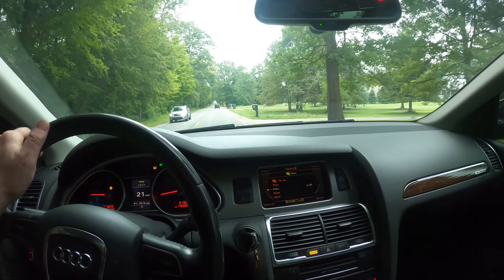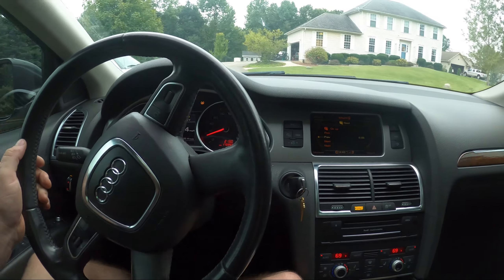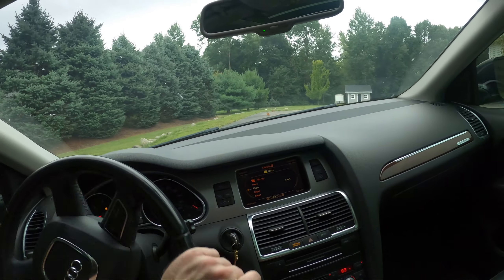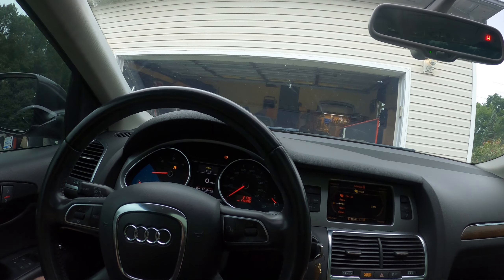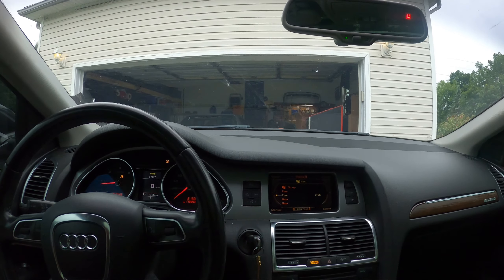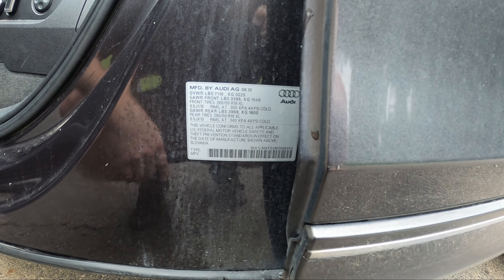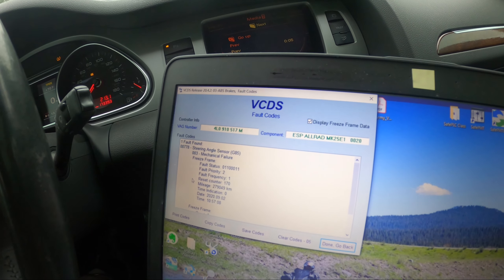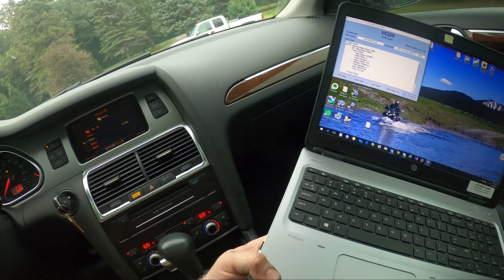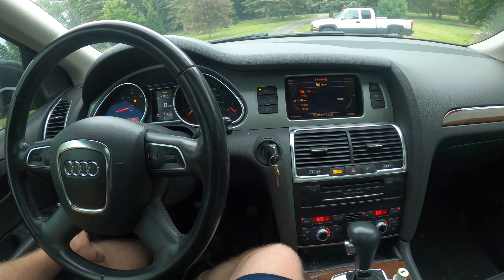Initially, no strange feelings - the steering feels good, it's not making noises, it's not jerking around. I think we're in business. Next we'll have to clear the stabilization fault, otherwise I think we don't have traction control. We'll double check air pressure on all the tires before we reset the monitoring system - it uses the ABS sensors. And we're getting a mechanical failure for the steering angle sensor, which is turning off the ABS and traction control and causing the TPMS fault. There's probably an adaptation we need to do after replacing a rack like this.